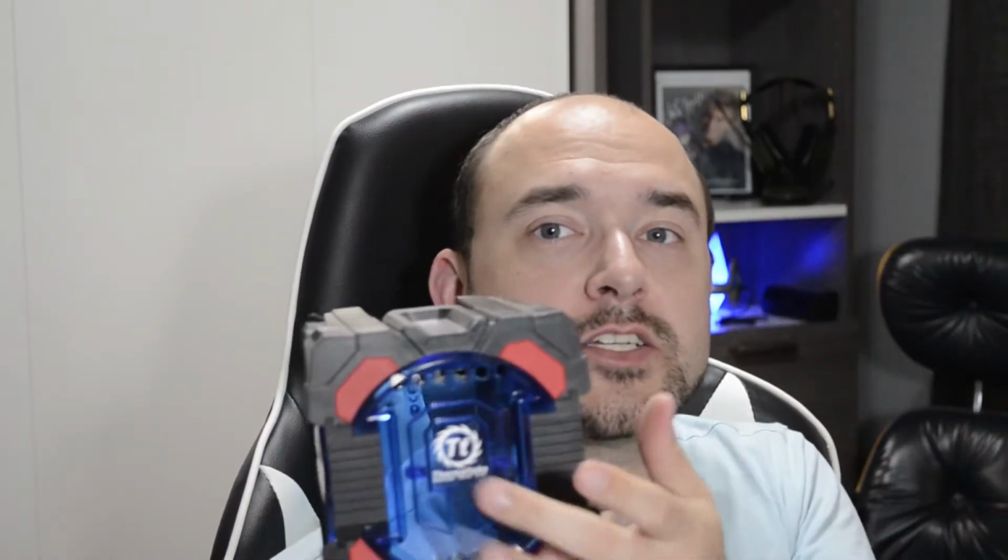If you have a fan that does not have an arrow, you can test it whenever it's turned on by putting up a piece of paper to it and finding out if it's gonna suck in the piece of paper or if it's gonna blow it out, which is my next step about this one problem I have with this build. So the blades are backwards in conjunction to the direction of my brand there, the logo.